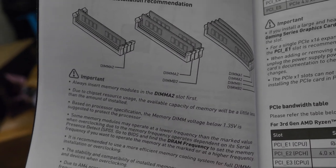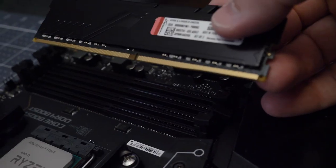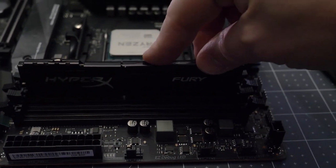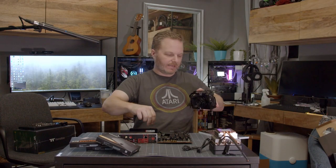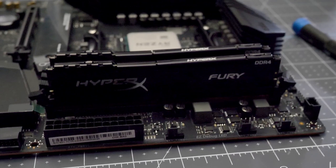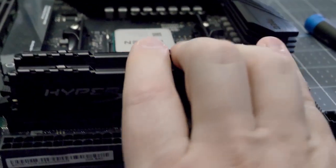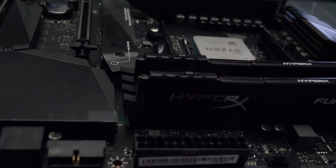So I'm going to do that to meet their recommendation. I'll open up the second and fourth slot memory retention clips, making sure the notch matches where the bump is. As I push down on this memory, watch the memory retention clips on each side — as I push this down, those two clips retain themselves and the memory cannot come back out of the board. I'll show you again: socket it into the appropriate slot — slot two and four on this motherboard. As I clip this down you'll see the two retention pins pop in. You need to make sure these are perfectly in line, which indicates your memory is properly seated. If it is not properly seated, the computer won't boot — you'll get beeps or light signals off the motherboard and you'll be in troubleshooting mode.